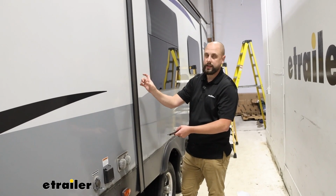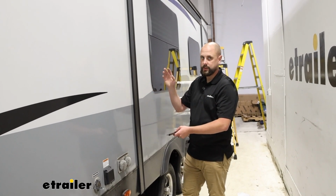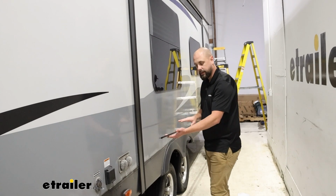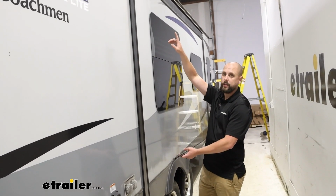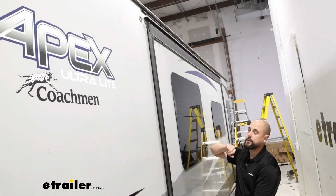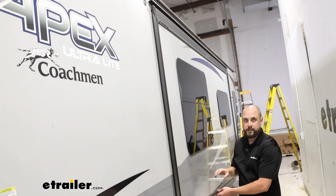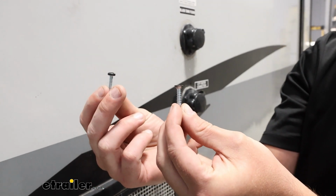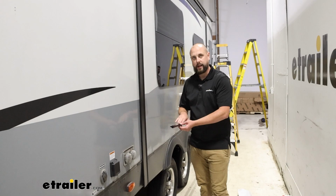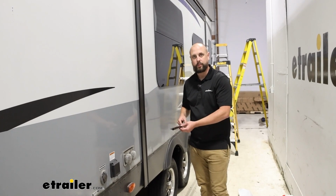We want about a 3-inch overhang on each side. So we would just factor that into where we would cut the rail. Ours is already set up here to where we don't need to do that. But there is a set of pan head screws that is intended for these. There's 2 different hardwares, and the pan head is what would hold up this top rail.